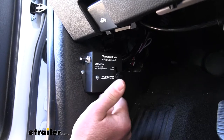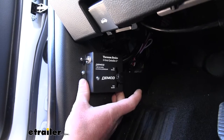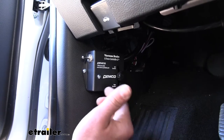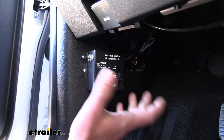The G-Force controller also plays a part in determining when to apply your towed vehicle's brakes, because it has an inertia-type sensor inside that detects movement. The braking system uses that information along with the brake light signal from your coach to determine when to apply the brakes. For example, if you're driving, hit the brakes in the motorhome, the system sees the brake light signal, communicates with the inertia switch, confirms you're moving, and applies the brakes in the towed vehicle.